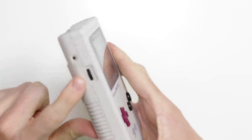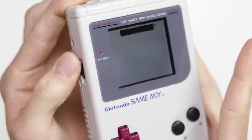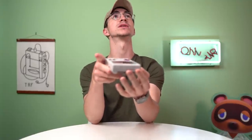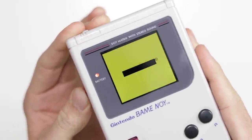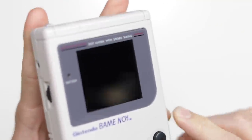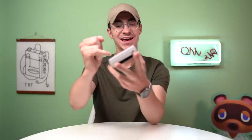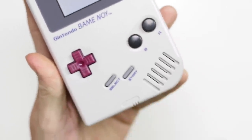One of the things I installed — there are two things I did that you saw in that little montage. The first one: on the side here where the old contrast wheel was, which is now going to be your brightness wheel as well as the button which you press in to cycle through the different colors and color palettes on your screen — you're going to need to shave off that piece of plastic. The other thing I did, which is really optional, is I fitted a light leak sort of bezel piece around the inside, 3D printed, available on Retro Modding. I'll leave everything about Retro Modding, the prices, the links, in the description below.